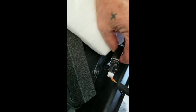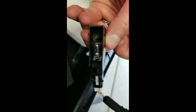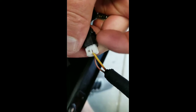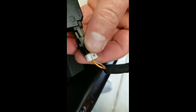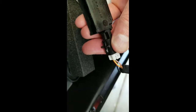There are little tabs on here — you can pull this up and loosen the tabs, and your bulb's under there. That thing's hot, so I'm taking the bulb out. There's no need for it anyway because I'm going to have my other puddle lights on there. So I'm just going to pop the bulb and see where I'm going to splice in. The yellow is your ground, and the gray-orange is your hot. So yellow is your ground and the other one is your hot.